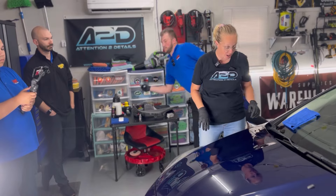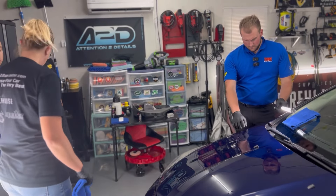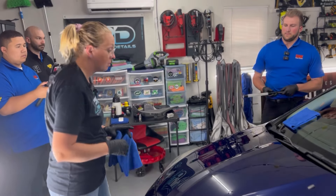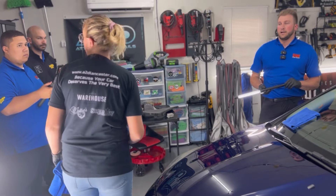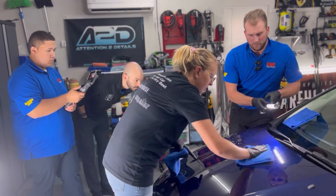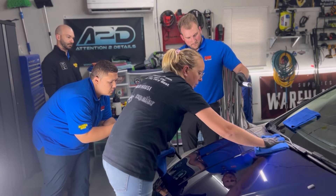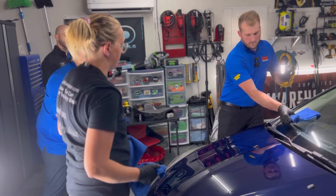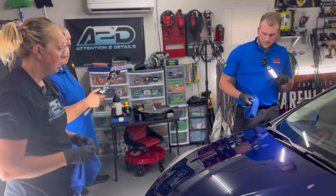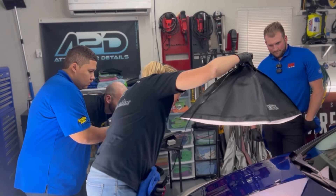It's rainbowing quickly — I do have the mini split blowing right on it, but it looks like it's almost evaporated. It looks like it's ready to level. Work time will change with humidity and heat; hot and humid will flash a lot faster than cold and dry. You can see it's mostly evaporated, but it still doesn't feel grabby. With one towel I don't even know if you technically need a two-towel method — I didn't feel like I was pushing around a lot of product, streaking, or getting high spots.